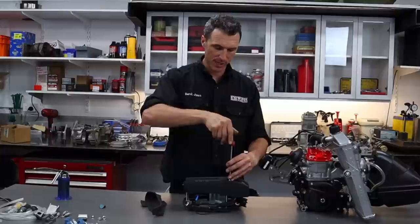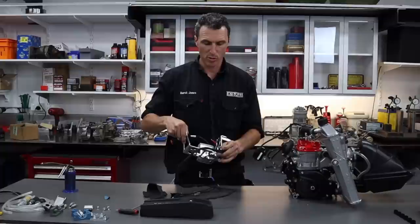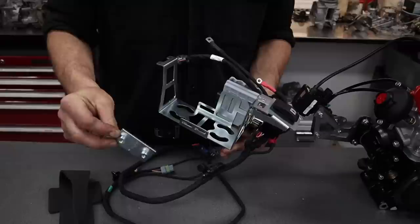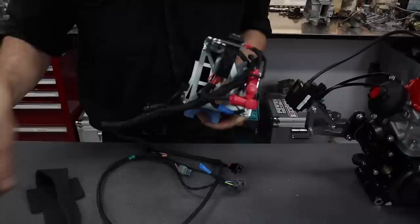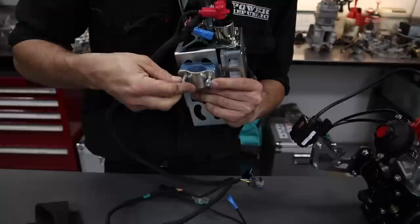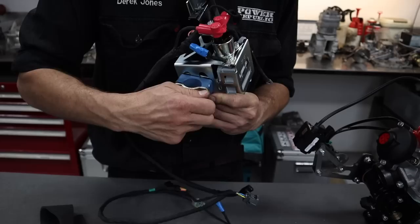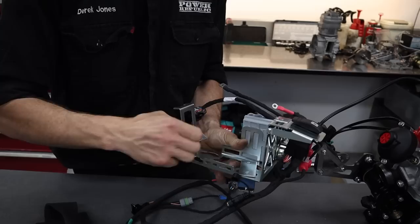We have the battery bracket here and we're going to prep that ready to go on the kart. Grab a 4mm Allen key — this just peels off, this is how it all came from Rotax. Undo the lights like so — here's the charging port so you can charge the battery. We're going to install the bracket, then get the chassis clamp that goes on top of the chassis rail, and then there is a bottom clamp. Two M6 cap screws go in — these things have to go in before installing the battery, otherwise you're going to have to pull it all out again to get those onto the chassis.